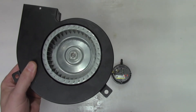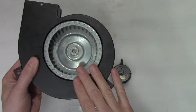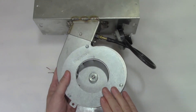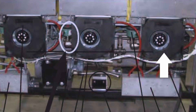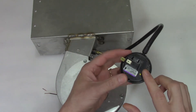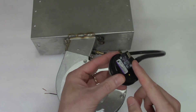To ensure the greatest chance of a first-time fix, take along the blower that matches the unit. Series 200 units built before approximately June of 2018 used a black house blower, and units built after this used a silver house blower. Be aware that Series 100 fryers use a different blower as well. Also take along a pressure switch and silicone hose. You can find these parts along with the serial number cutoff in the parts list.